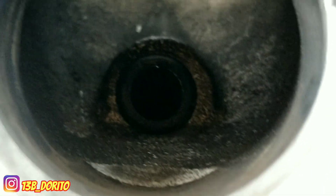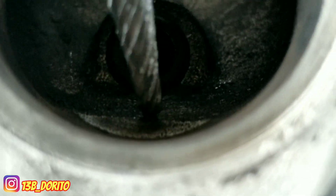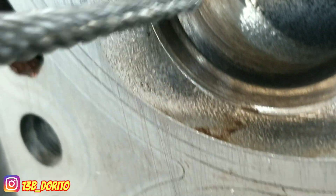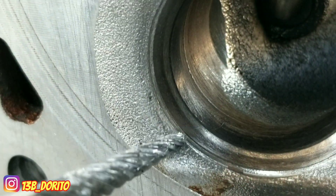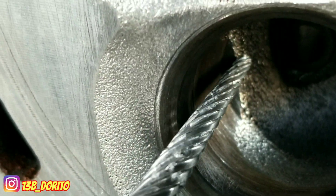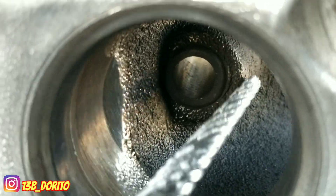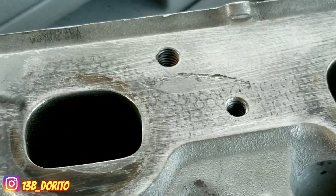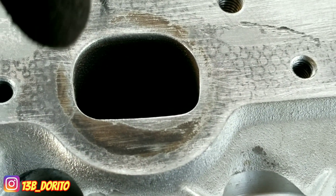We're going to get all the roughness smooth. The belly in here is also going to get removed. We're going to blend the valve seat with the aluminum head, and I have a measurement on this one. All I do is blend the guide and valve seat with the head, get rid of the bump, and smooth everything out and flush the aluminum head into the guide. For the exhaust side — never do the floor, or you're going to make a hole in the water jacket. You can match the gasket mainly on top and a little bit on the bottom, but I don't recommend that unless you're 100% sure which headers you're going to use.